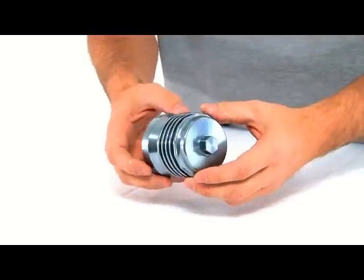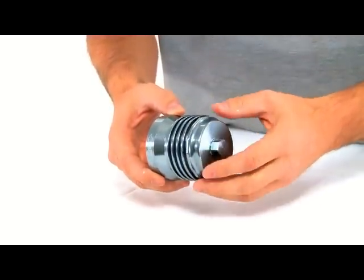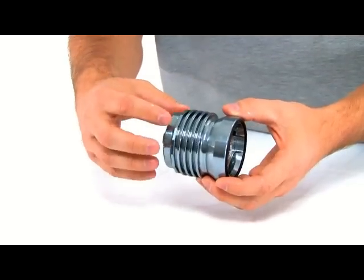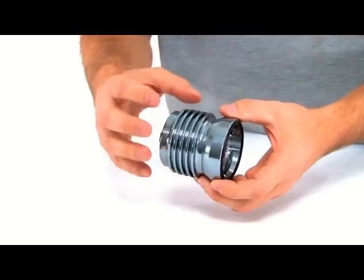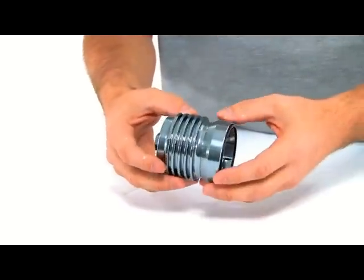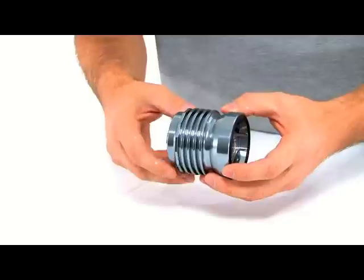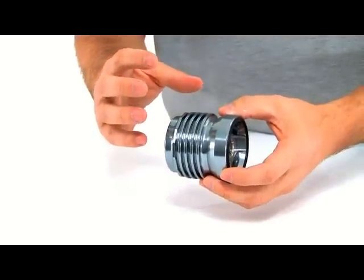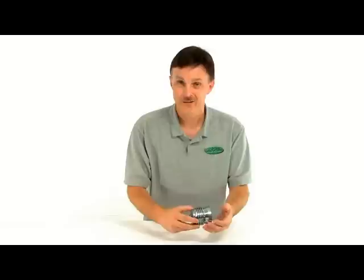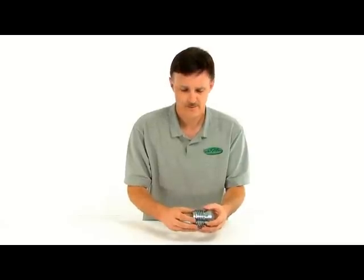When you receive this, you're going to notice a nice titanium hard anodized coating on top of the billet CNC housing. The manufacturer thought ahead and did two or three things. At first glance you really just see an oil filter, but it's more than that. The machine grooves here act as an oil cooler, so you get an oil filter and an oil cooler in one package. The billet aluminum housing actually dissipates heat very well, and these fins act as an oil cooler — that's a really nice added feature.